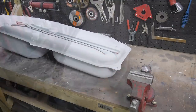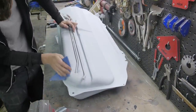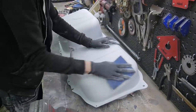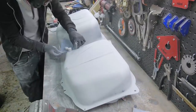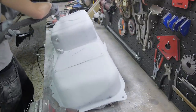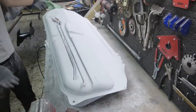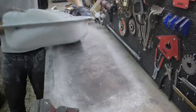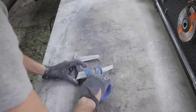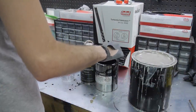Once that was dry, I dry sanded it flat with 400 and then 800 grit sanding foam pads. I did the same for the brackets. Even though you can still see some pitting, I like knowing it's original. Next were two coats of quartz deep black base coat.